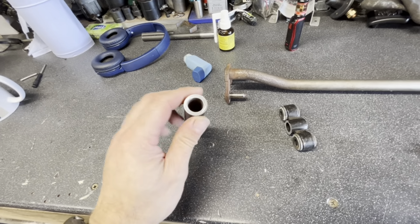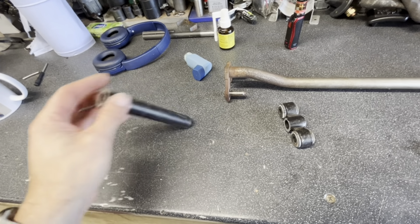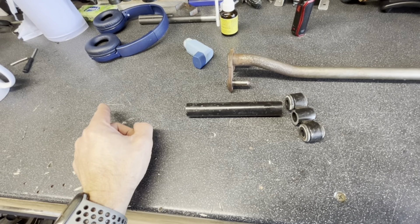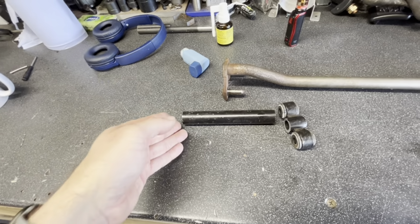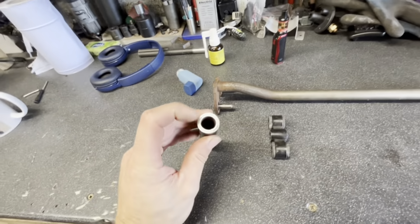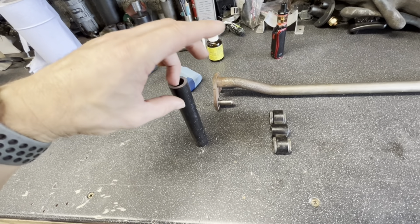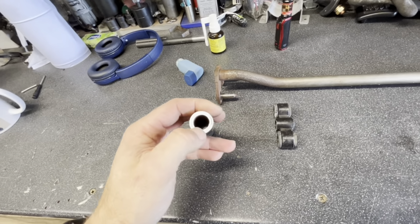It is really thick wall. Then I cut it to length by putting the stub on the rack, seeing how far it stuck out, and chopped it off basically. So I could then bore that out on the lathe to our 15mm dimension that we need - that is just under 15mm.